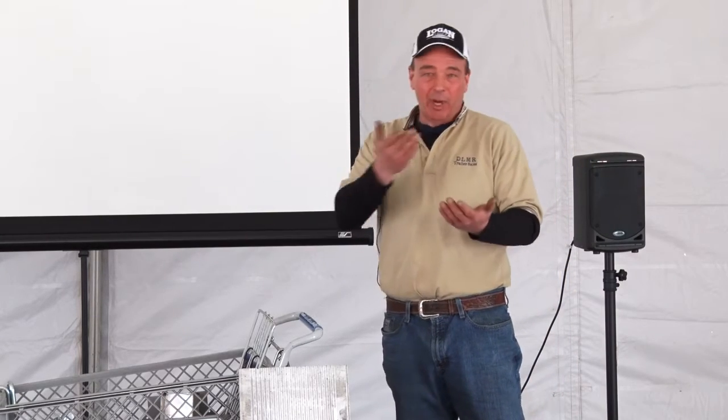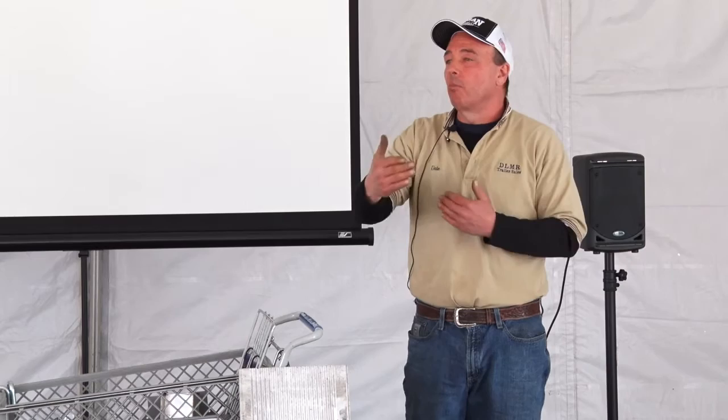So before you acquire a trailer, look at your owner's manual. Don't trust anybody to tell you that truck's going to haul it. It's right in the owner's manual, it tells you what the capabilities are of that vehicle. I recommend don't take it to the limit, because everybody overloads their horse trailer. By the time you put 2 horses in, and like I say, we're going to go for a weekend trip, you load it down. You need to give yourself some room, because you're going to overload it.